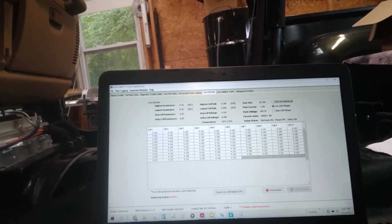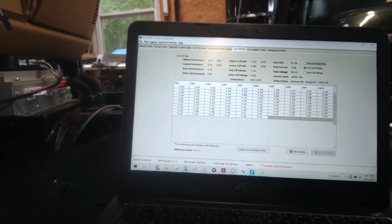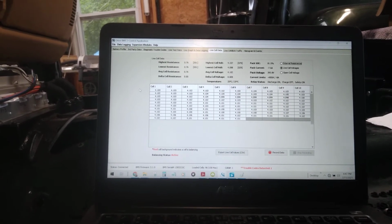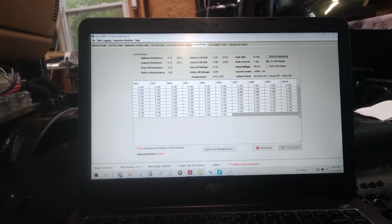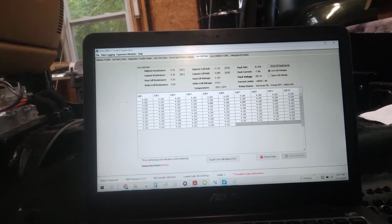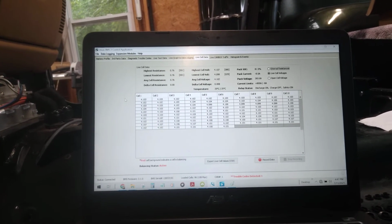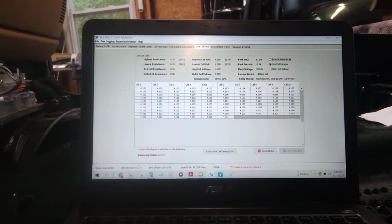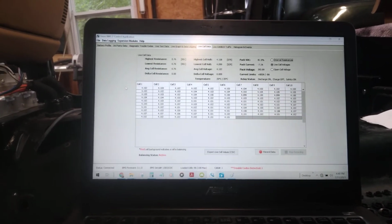And the trigger, which is the green wire on this thing, is going to be the switch that's on the steering column. If that switch is activated during that 10-second time, it'll reset that time. If that switch is active and remains active without cycling, then that timer will go off and it'll turn the pump off. If that switch goes to off and the timer runs out, it'll turn the pump off. And as soon as that switch happens again, then the pump comes back on.